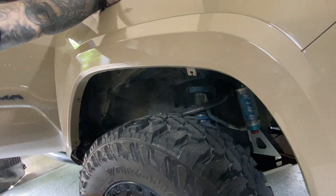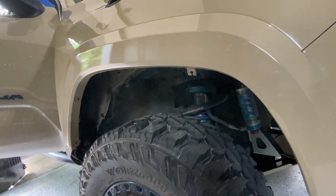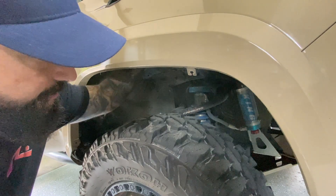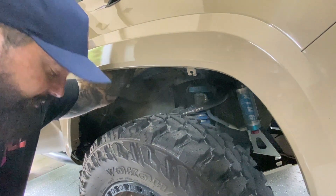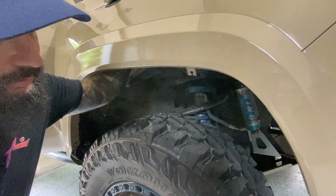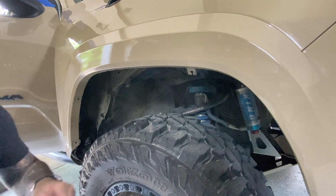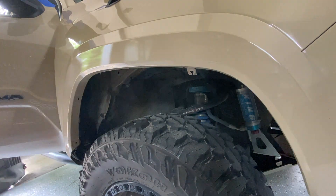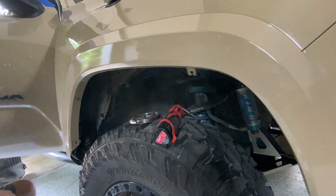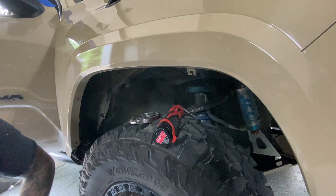Now I'm down here setting up all the connections so that when we bring in the actual intake everything is ready to go. I'm taking this piece of tubing and putting it into the 90-degree elbow. When you put the clamps on, make sure they're pointing down so you can screw them in later — otherwise they get very difficult to access. I'll leave everything pretty loose for now, then we'll get the snorkel in and put the straight piece on with band clamps.